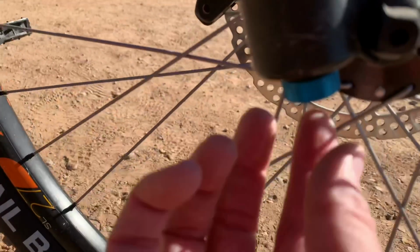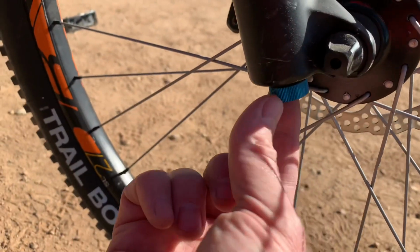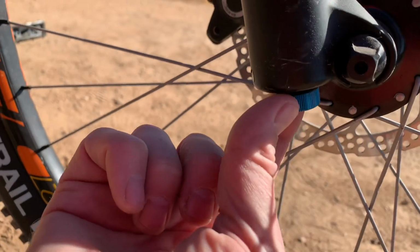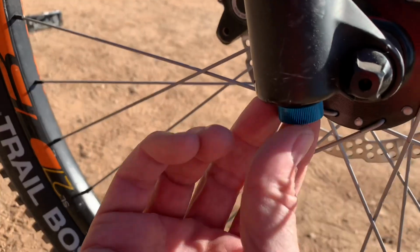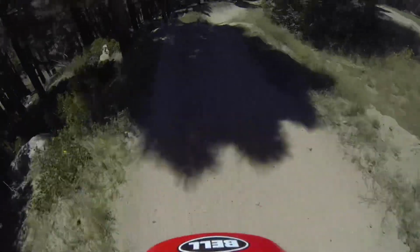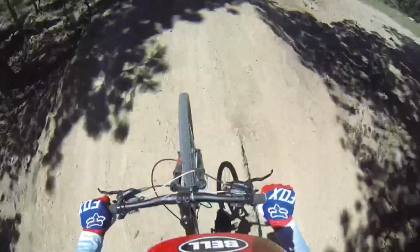On the bottom, you've got rebound damping that you can control. The compression damping on the top, you can just turn on and off, but the rebound damping you have some control over. And this all adds up to a really nice handling fork that you can just take out and ride and be comfortable on slow roads if you're an old man like me, or my son pounds the hell out of it going downhill.